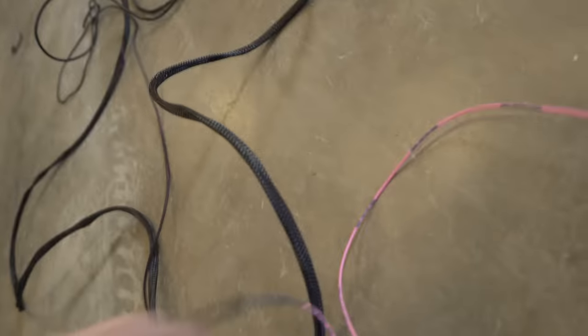Still need to connect the two main wires to the battery, but first running the rear lines and the exhaust from the manifold. Lines run from the manifold, under the trunk floor, through the spare tire well — there's a plug under there to run two lines through, one to each rear corner. Also run the manifold exhaust line out through that same area. Once that's done, plug in the controller and we're ready. The rear lines are super easy to run because they're so short.